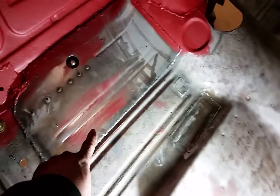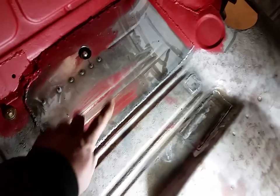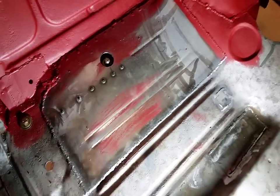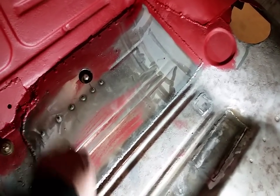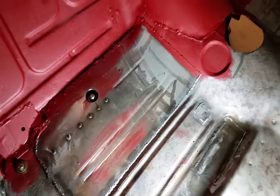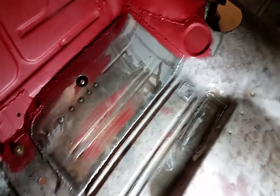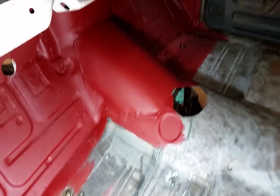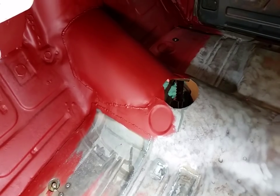I did make a patch panel for the floor and I should have videotaped it but I didn't. There are a couple bad spots — one spot here, a little bit right there — but this was the biggest spot, so I just cut it all out and made a new one. I even put the little dimples in there, the ribs, cut the hole out for the body mount, and plug welded it in for the lower support. It's not pretty but it'll work. The rest of the floor is rock solid, even on the other side. I did extend my trans tunnel up a little bit so my transmission will clear.